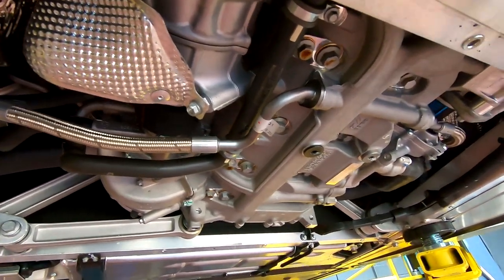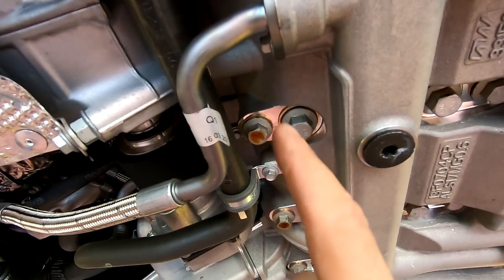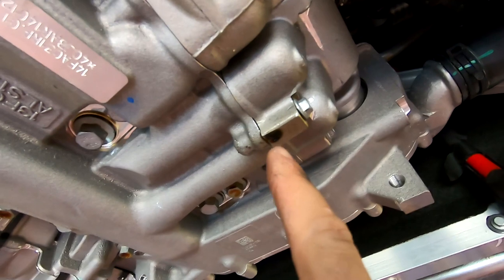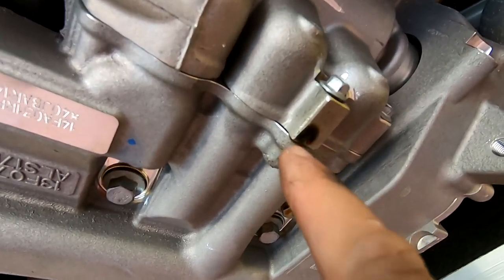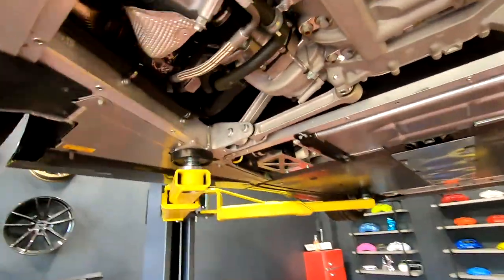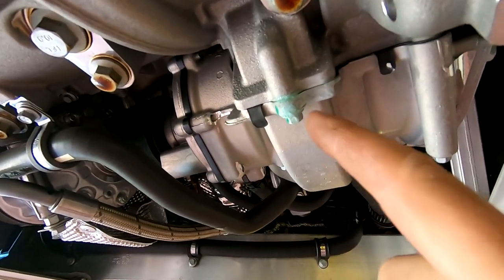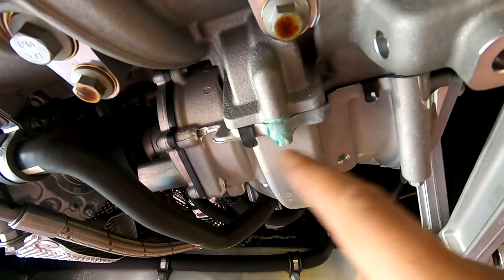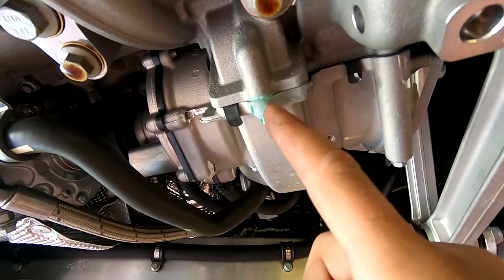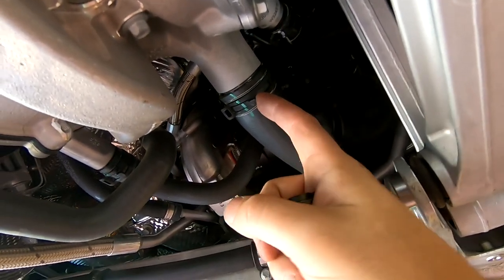While you're doing your oil change and draining, you should look for coolant leaks, oil leaks, any other type of leaks. Now the heads of these bolts have got some oil on them, and believe it or not that is normal. It does happen quite a bit - it happens on the 3.8 liters as well as the 4 liters. No cause for concern there. This I'm not exactly sure about - that might be a clean and see if it reappears from that gasket right there. We did notice that on the bottom of the tray there's some coolant residue, and where that is coming from is the water pump seal right here. We don't know if that has stopped leaking - there's nothing wet, so at the very least it's not a very large leak. It is worth cleaning this off and seeing if it reappears. I would not go ahead and replace the water pump gasket as a result of just that, but it is something to look for. Check all your hoses, make sure your clamps are good. These are different clamps that are much better than the ones that have been on previous cars.